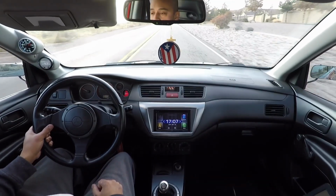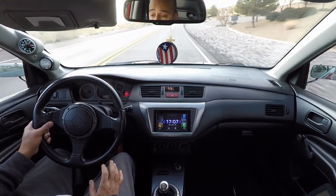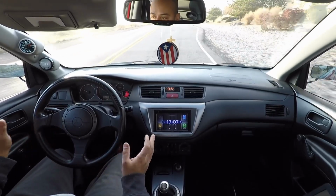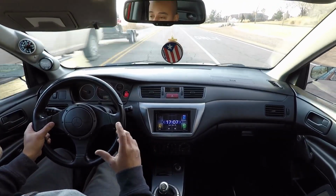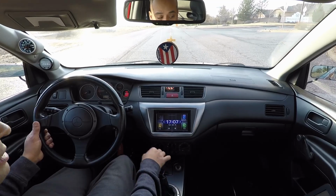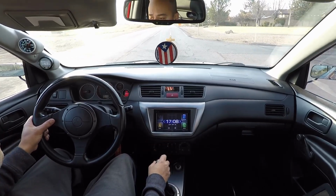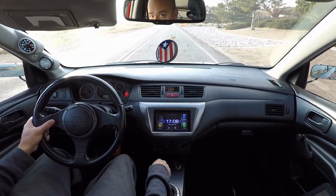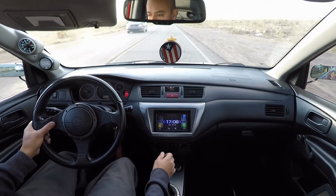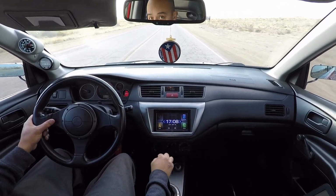We're picking back up here with version 5 of the map. So I had to take a little bit of time to figure out my wastegate issues, and I have a new mic, so hopefully you guys are able to hear me a little bit more. It turned out, after doing some testing, you guys should have seen this in the previous video, the springs weren't what they were listed as. For example, the black spring, which is what I have installed right now on the wastegates, I believe those were like an 8 psi spring, and I was actually getting them to crack open at about 11, fully open by like 13, 14 psi or so, actually 15 on my bench test.